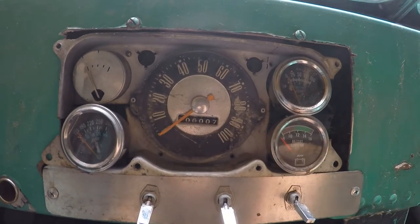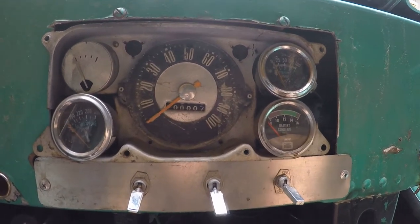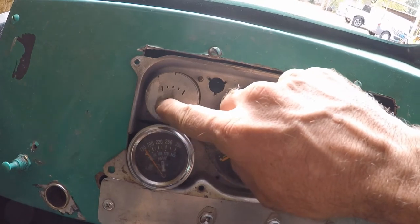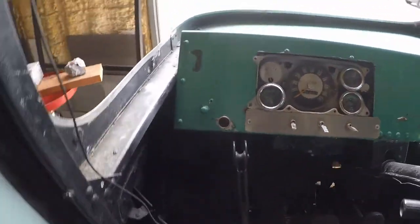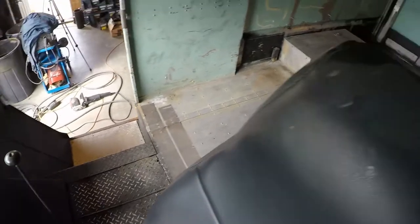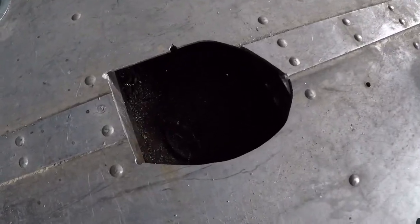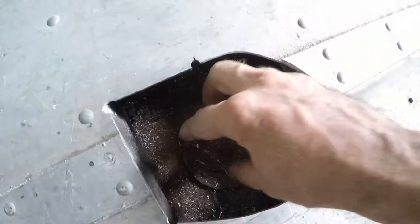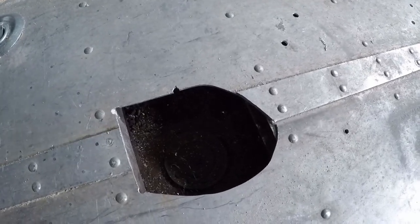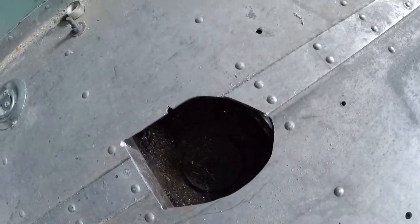So I'm putting in a GPS speedometer because this has the old mechanical cable that goes into the back, and those are not super reliable. And then the fuel gauge is the one that does not work, so I'm going to put in a new fuel gauge. I'll show you how I'm going to do that — it's kind of cool. It would have been not cost-effective at all to pull the fuel tank from the bottom because it is in rough shape. But here's the fuel sending unit, and what I'm going to do is pull this unit out, and I have a new universal unit that I'm going to modify the top of this to accept.